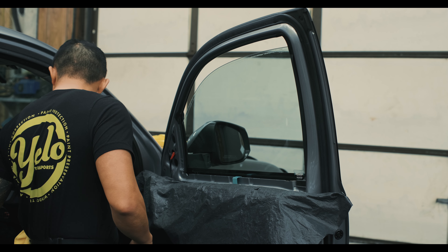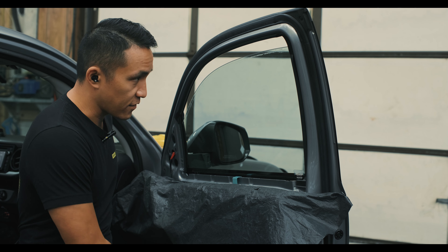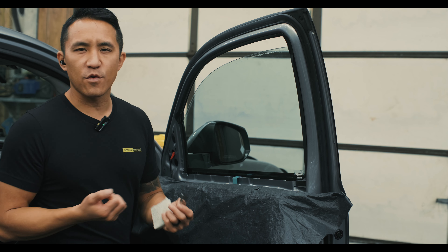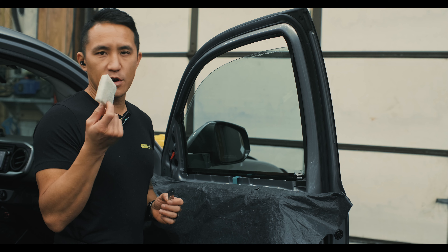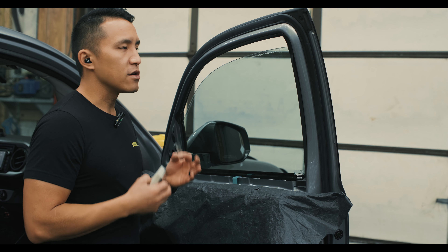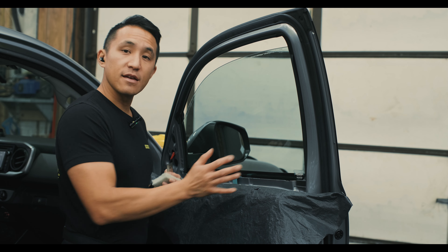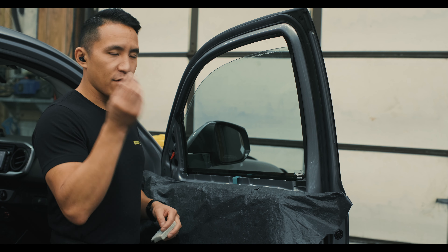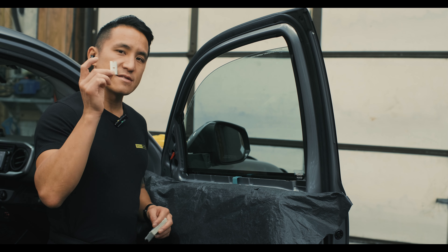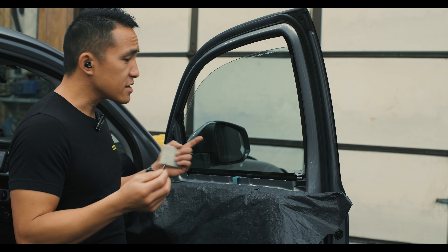The next thing I'm going to do is razor blade this whole glass. I'm using a stainless steel razor blade. Here's a key tip: if you have a car that's 2020 or newer — something that's probably three or four years old — a lot of times the scrubby pad is going to do just fine and get rid of any small dirt stuck on there. I've always started with the razor blade so I tend to still use it, but just make sure it's stainless steel so you have less chance of scratching.